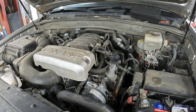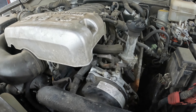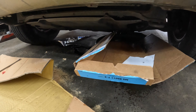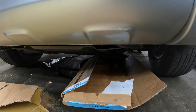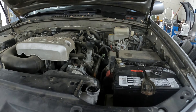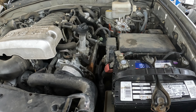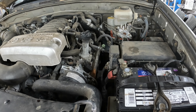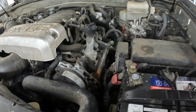When we're doing the timing belt we're going to go ahead and do a water pump because it gets turned by the timing belt on one of these. Right now I do have the coolant draining. The drain valve is on the bottom on the driver's side and you can reach in through the tire and open it up — it's just like a little butterfly valve. If you do have that skid plate underneath there, it'll run onto that and come out of like four or five spots.